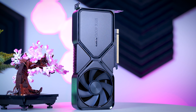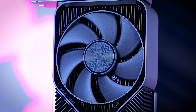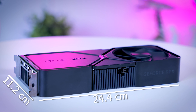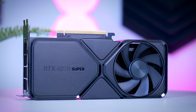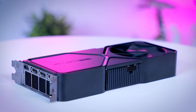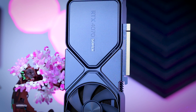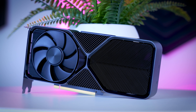The Founders Edition from Nvidia is a very elegant little card. It is completely made out of metal just like the previous FE cards, but the new Super models come in this nice matte black color which just looks fantastic. It is 24 centimeters long and two slots thick, easily matching a lot of cases. It doesn't have any extra features besides the typical three display ports and one HDMI port on the back, no dual BIOS, no RGB. It's an MSRP card so it should cost you $600 or €670, but unfortunately Founders Edition cards come in very limited numbers and are often out of stock in most regions.